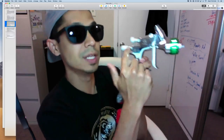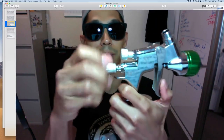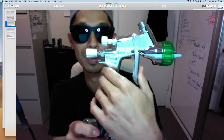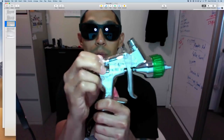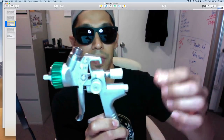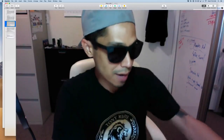The adjustment in line with your fluid tip is for material flow. I always like to keep this open — back it out, squeeze the trigger, then tighten it until it gets snug, and you've got full fluid flow. This knob here is for your fan pattern — wide open gives you a wide fan, narrow closes it down. On the X27, the fluid flow knob is here, the fan pattern is on the side like the SATA, and the air inlet is here — keep it wide open. Adjust your pressure at the bottom with your gauge.